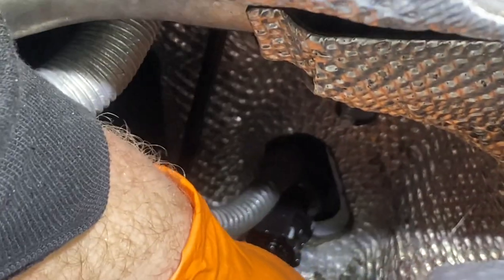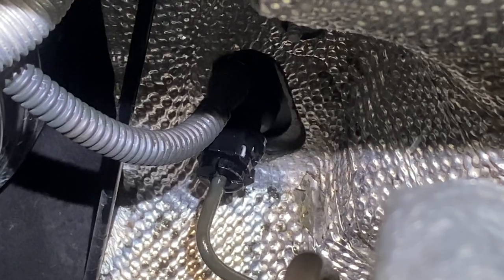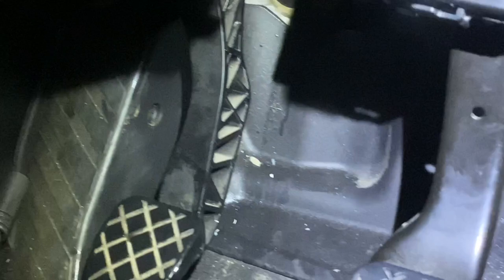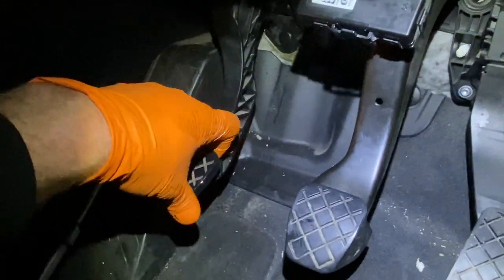I pop in the pipe — in theory that fluid should flood the little pocket in here. I give it a push and there she goes. The clip has popped into place, the seal inside is sealing. I'm hoping that at this point I have my clutch pedal. But no — my magic didn't work on this occasion. There's a little movement at the bottom but not enough. I'll have to go and bleed anyway.